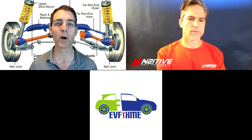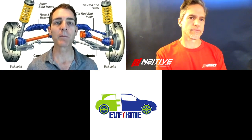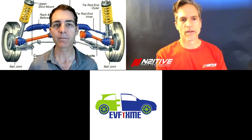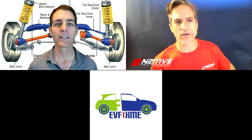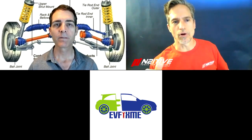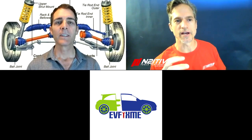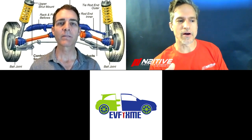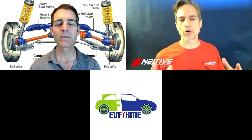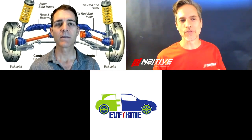We've talked before about how this is part of an overall issue with not only this but rear tire wear. The parts that you sell at Intuitive help with this issue as well because some of your parts allow you to lower the car. We're selling the same kit Tony has on his car, which basically lowers the car a little bit to allow the half shafts to be more at a straighter angle than they are now. That relieves some of the binding and tension that can build up, which is wearing them out. From what I can see, the purpose of the clevis mount refinement was simply to absorb the vibration that was coming from the axles, not to alleviate the root of the problem to begin with.